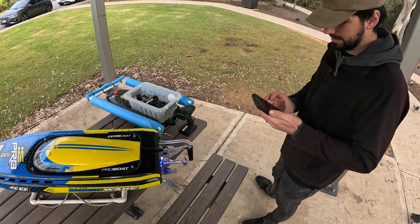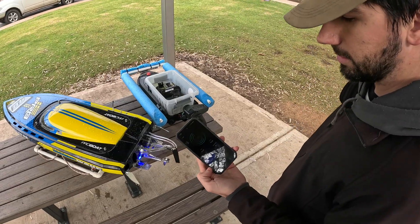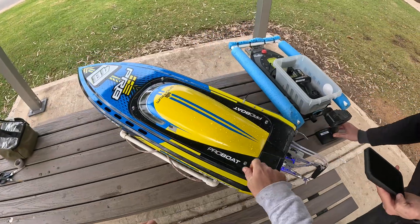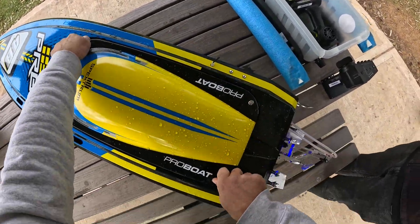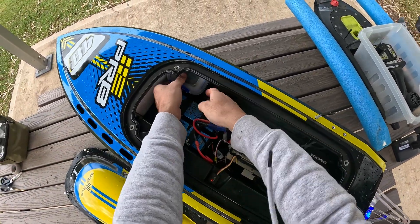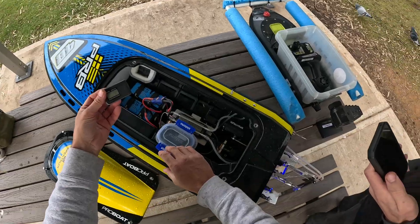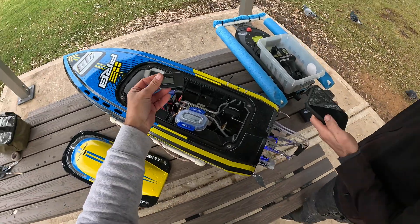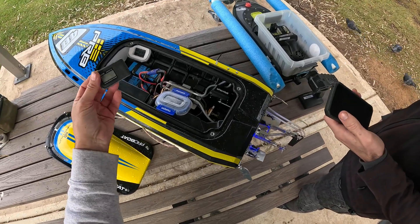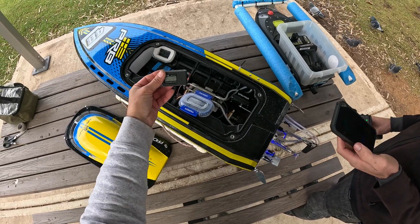My rudder's gone. Did we get any readings on there, Brock? We got some. The ESC's up to 32. Did we get a max amp draw? We'll check the speed while you're looking at that. So does the SR setting rob speed or not? Wow, okay, well that doesn't seem right - did 90 k's yesterday, did 79 today. Very strange. Same prop, haven't changed one thing on it, exactly the same batteries, haven't changed any settings. I don't understand that.